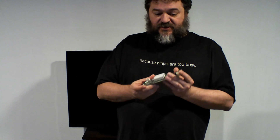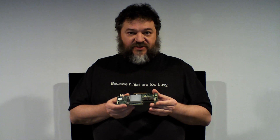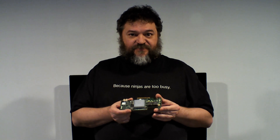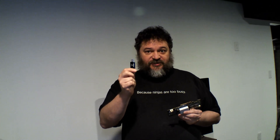That's just two screws, and this way it will fit exactly where the H700 goes in my machine. I'm going to flash the H200 card into HBA IT mode, and right here I've got the USB drive that I downloaded the upgrade to.